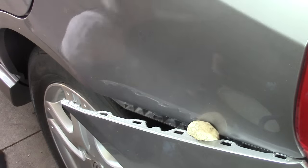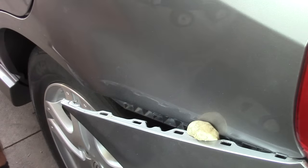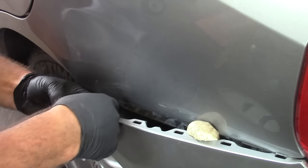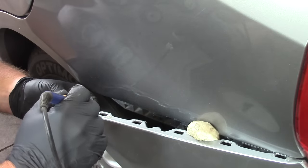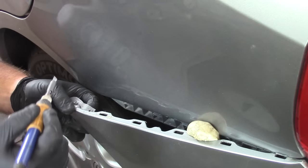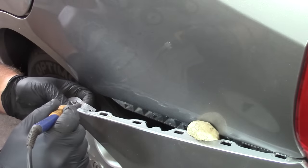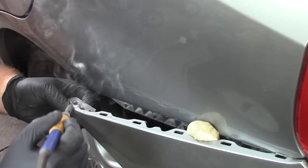I think we're ready to go. We're going to take this patch, stick it underneath here — I've got a little putty stuck in there to hold it out — and we're just going to start by trying to tack this thing together, putting a couple of tacks going down. Bumper plastic melts very easily; it's an easy plastic to melt and weld.